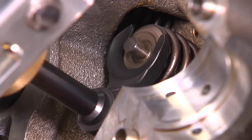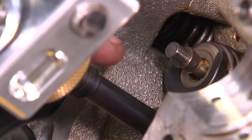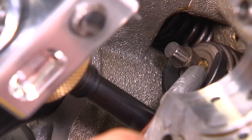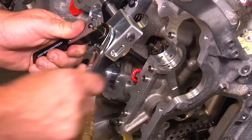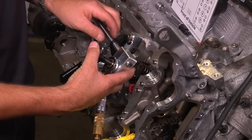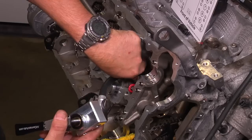While holding onto the rotator handle and turning the ratcheting wrench, you're compressing the valve spring. Once the valve keepers or collets are fully exposed, remove them with a magnet. Reverse the rotation on the ratchet and release the compression on the valve spring. Keep the assembly together, slide the rod out, and pull out. You can remove the valve spring by hand.